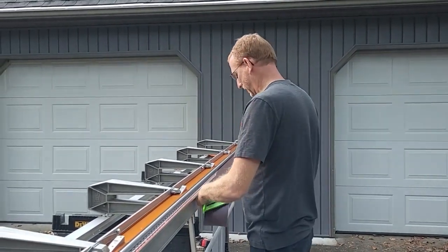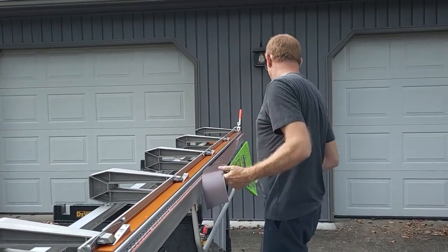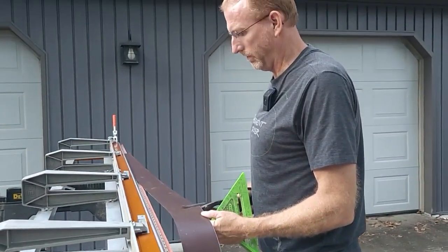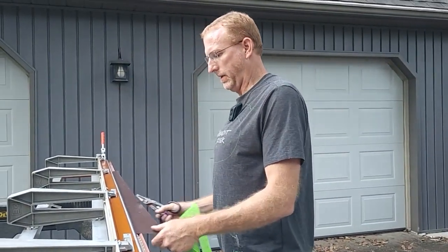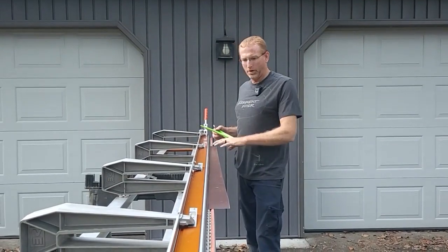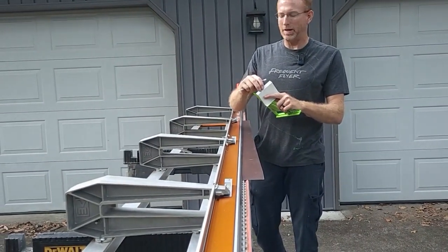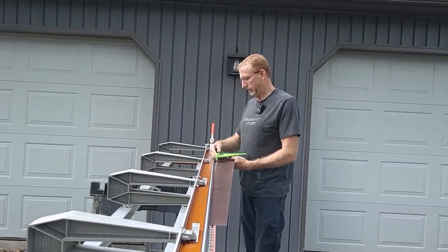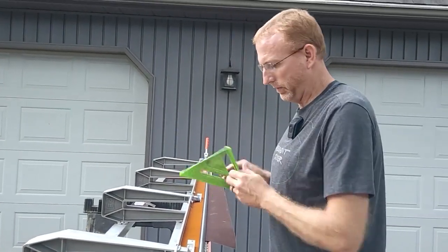I've just got a four-inch strip of aluminum trim coil cut, and that should be the length I need to make the two bends and get the straight area to cover that material. I'm just going to square cut this end using a simple pair of sheet metal shears. Then I'm going to mark five-eighths of an inch on this edge, which will give me my first bend — that will be the piece that actually lifts up underneath the diamond plate.